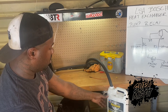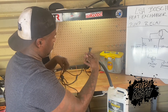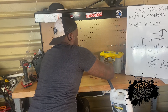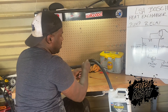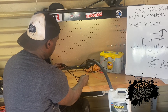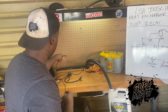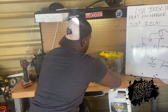So now that I got the props set up, first thing I want to do is plug into the actual pump itself. Slide this clip onto the pump — got that set up, I don't want those two touching. Next, we need to run our constant hot coming from number 30 on the lower part, and run that all the way up to the constant hot. We're going to set 86 right here — 86 is going to be our trigger. I'll get to that in a minute. Now we have to ground it out — take our two ground wires, get those together.